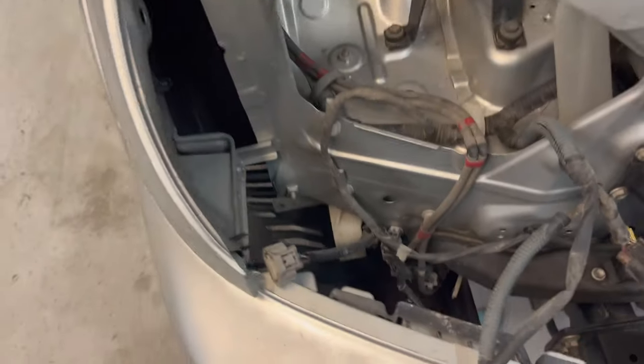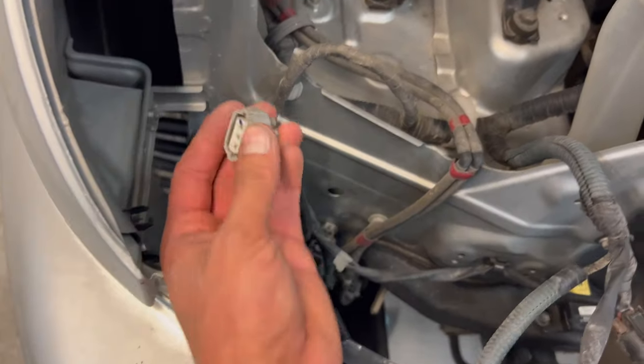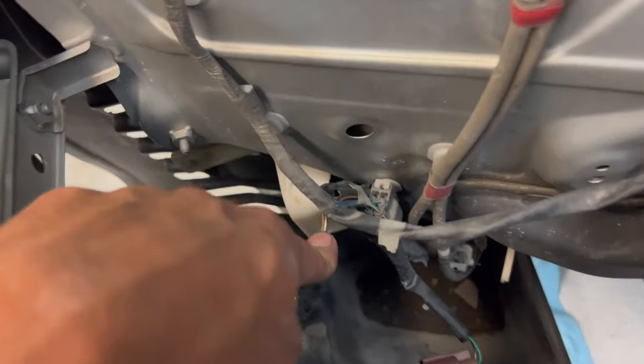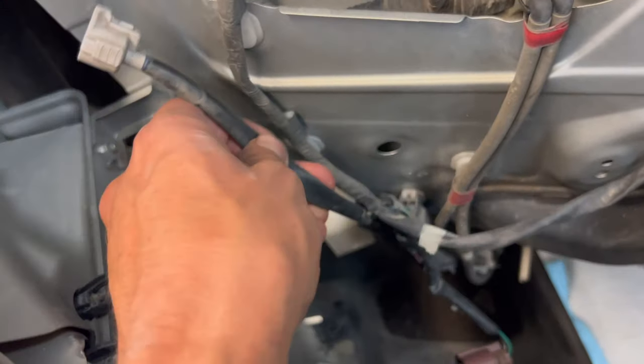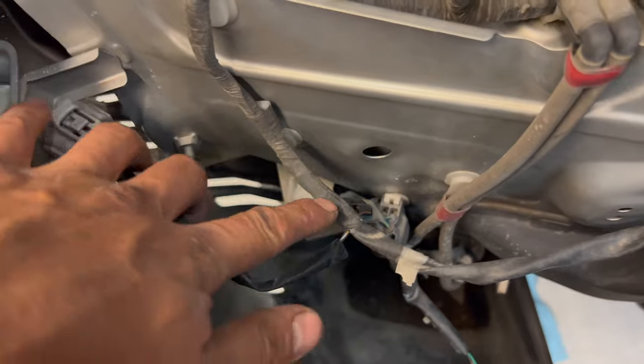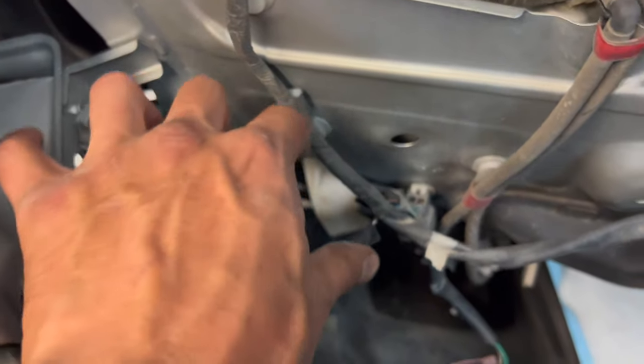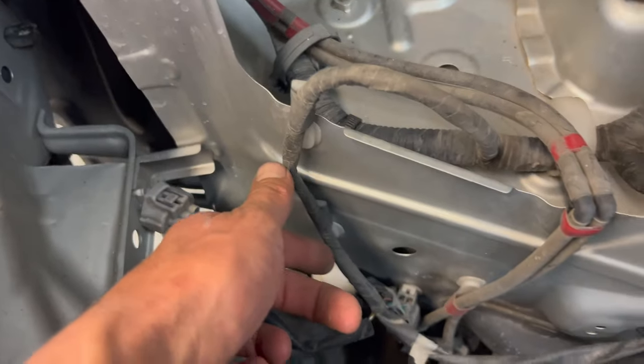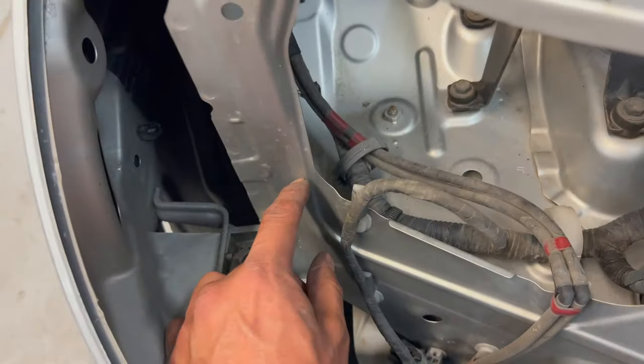The final step prepping the car is this needs to be longer. It needs to plug in right up around here, so we need to figure out how to extend this wiring. I don't actually want to cut and extend all of this, so I'm gonna cut back this shielding and see if I can pull. If I can pull 2 inches, that will give me 4 inches, because it will pivot up to here, and then I'll have this length from up here.